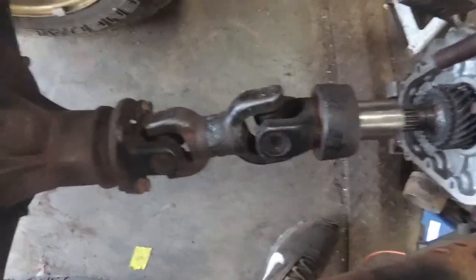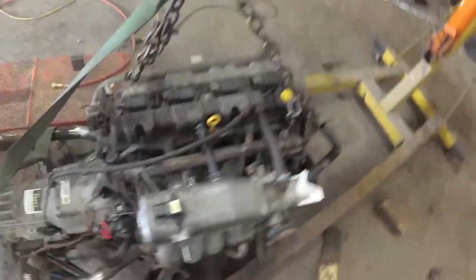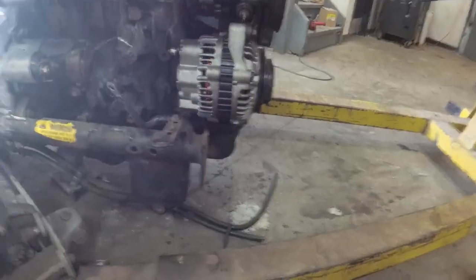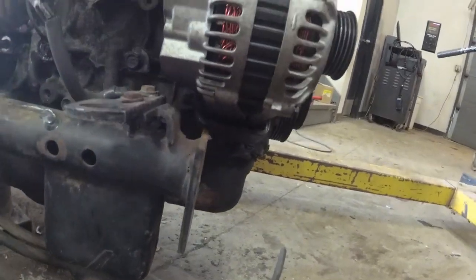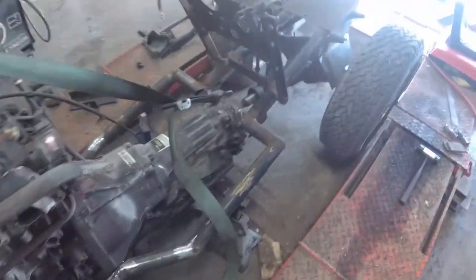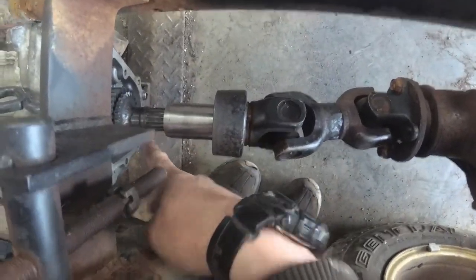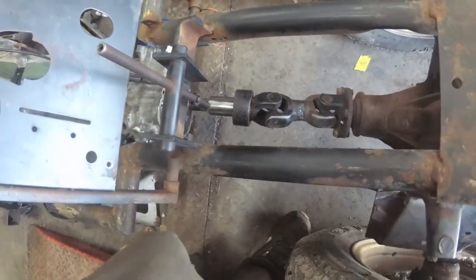We did the drive shaft. I got the drive shaft open and the motor's sitting in. It's a shame, but it is going to stick out a little bit — about two inches out. So we're going to have to deal with it. It's in as far as I can go with this drive shaft. This will slide all the way up there but it's only going to give me like a half inch, and I want some play there.